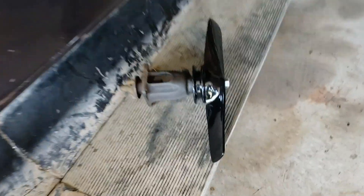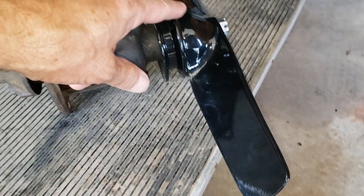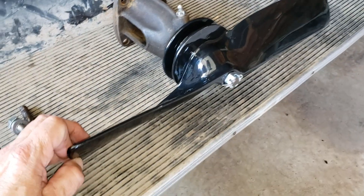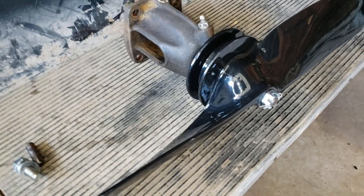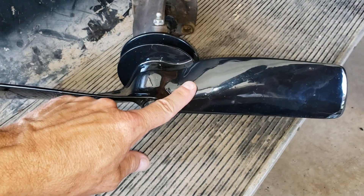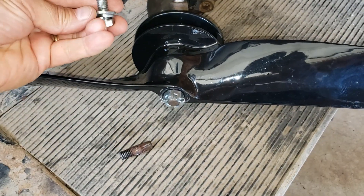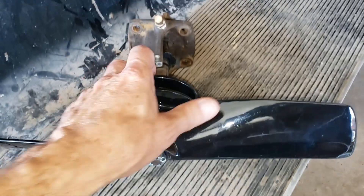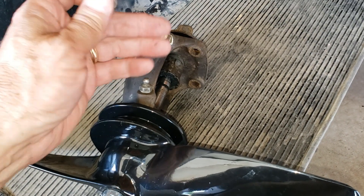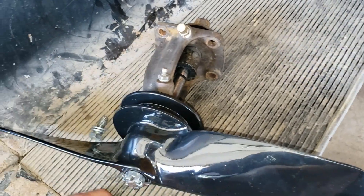Here's the old water pump — it didn't leak, believe it or not. I was also able to get a new aluminum fan blade and get that installed on there. The original one had a crack in it, and reviewing online posts, people said these blades can break off if you use the original steel one. So I'm going with the aluminum blade. And instead of studs, I'm using bolts because in the future if I ever take this pump out, it'll be a lot easier — I'll just pull the radiator back a little bit and pull it right out.